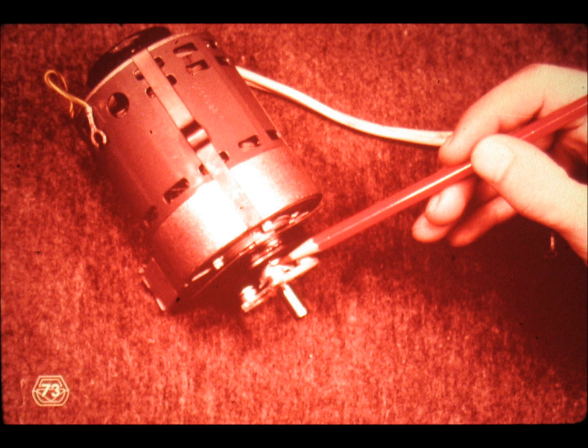Because different motor belts do not always track in the same manner, it may become necessary to refine one or more of these adjustments after the sequence has been completed. For example, the angular position of the motor may need such a substantial correction that in carrying out the correction, you develop slack in the motor belt. You might consider returning to the beginning of this explanation for slide number 73 in order to review or even jot down the sequence which we just gave.